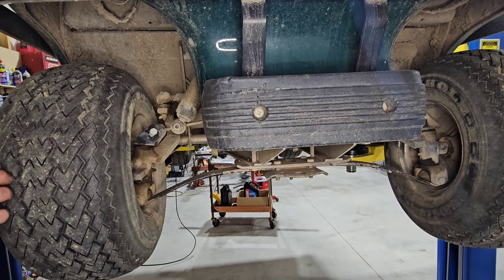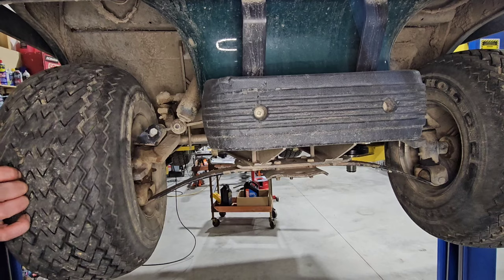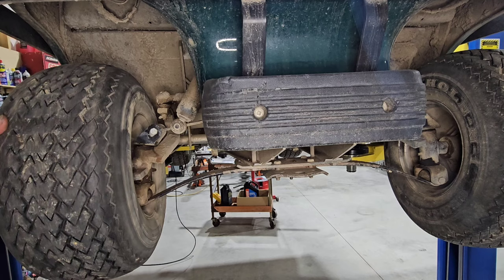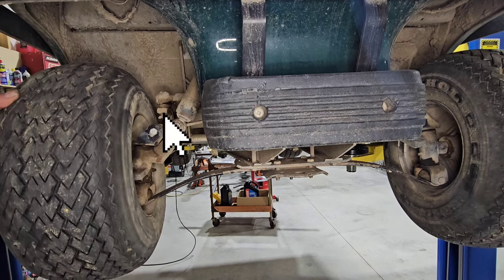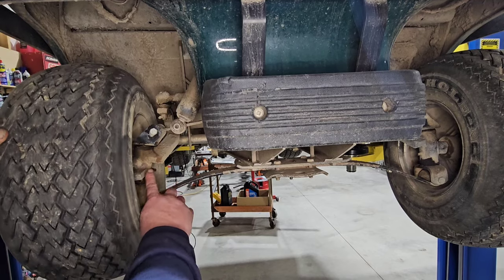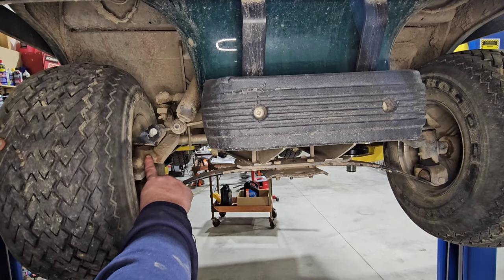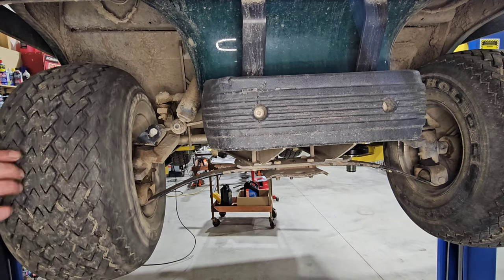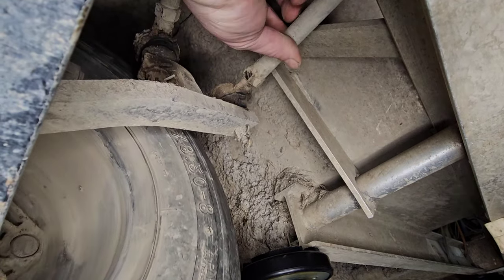This thing's got some wandering steering. You'll see in another video — I just rebuilt the engine in it, and while I had it on a lift I was going to lube it up. I came to find this insane amount of slop. Our kingpins do have a little bit of slop, but this video is just going to be about tie rods, and what I'm pointing out is this tie rod right here.